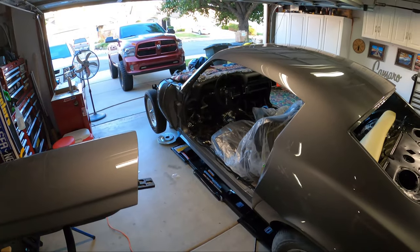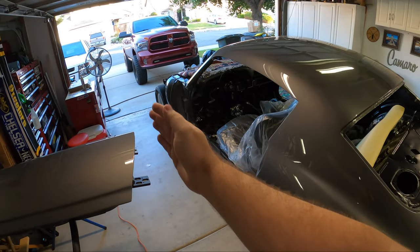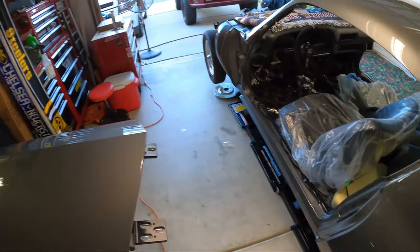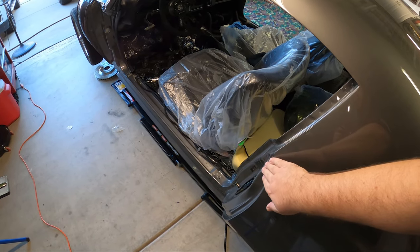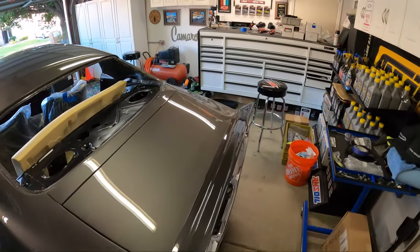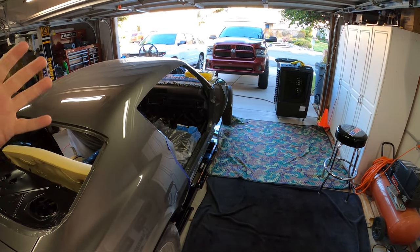Most builders and the gentlemen Heath and Craig who helped me do the bodywork all recommend the same approach: you start from the doors and work your way forward. So we're going to line up the doors, checking our gap along the back edge. We'll tape these edges off — that's really important because when things are painted you don't want things to chip. Heath is on his way over and I've been cleaning up around the car, making sure we have plenty of room.